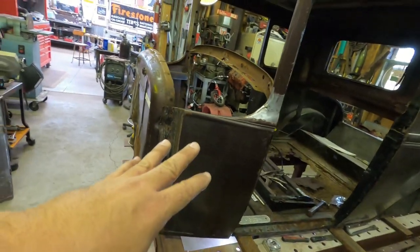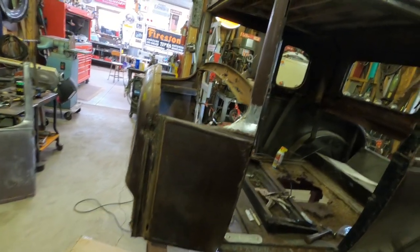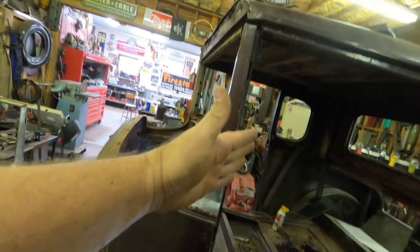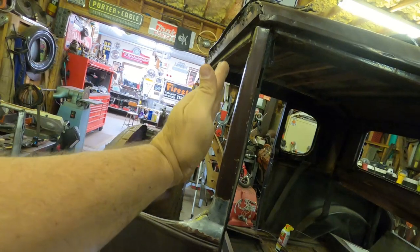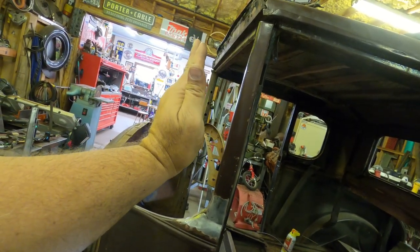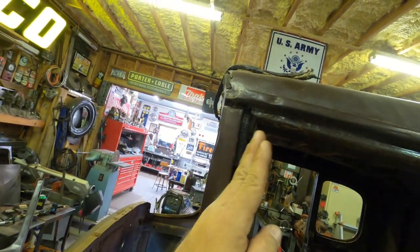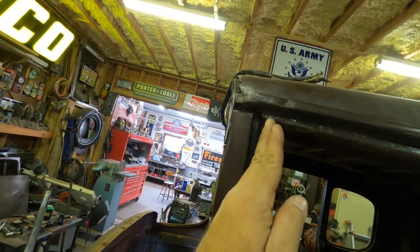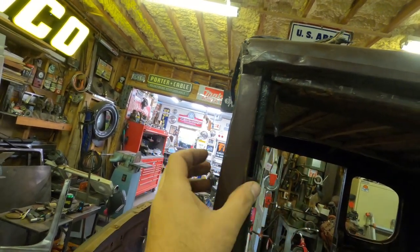I'm serious. So there's a lot of negative things going on with this cowl. And just a quick recap. The door got hit. There is damage to this cowl, and it made the cowl move forward. How far forward, you may ask? Well, it's about a half inch off of being where it needs to be. It's kicked straight out, and it's a little bit twisted.